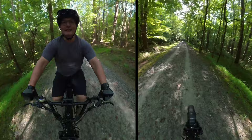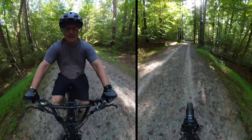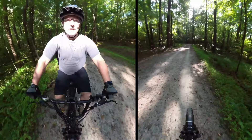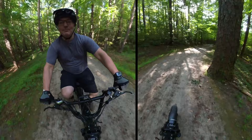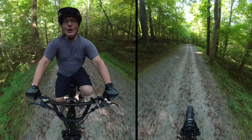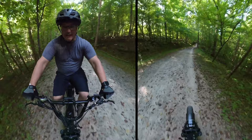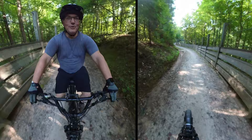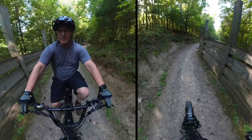It's in riding like this where you're really going to notice the speed-based pedal assist. I've got it at pedal assist level 2, but that doesn't mean it's weak — if I slow down, it'll get the full power going to the motor to try to get me up to the target speed, which I think is about 16 miles an hour at pedal assist level 2. But I'm still only going about 14-15 miles an hour because that's where wind resistance and rolling resistance of these fat tires is keeping me, as motor power tapers off as you get close to the speed.